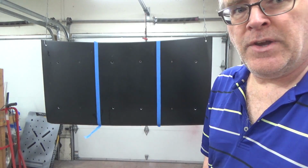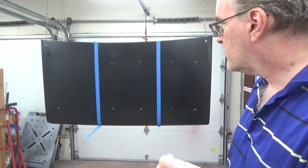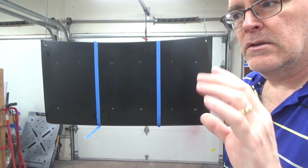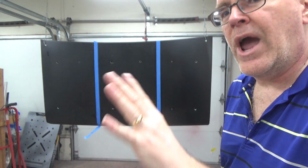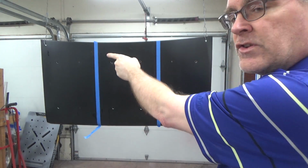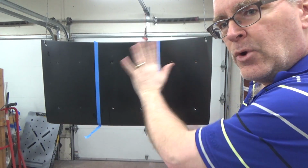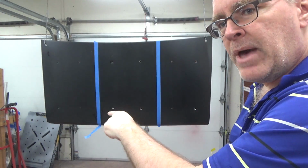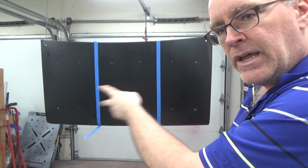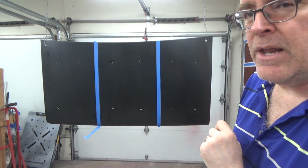I'm going to use the low temperature reducer, the ECR65 from PPG. The one thing I'm concerned about using accelerator is can you end up with dry patches, basically. So what we're going to do is put the first coat only up halfway across the panel-ish, right? And then we're going to let that sit for 5 minutes, and then come back and do the bottom half. And then we'll see in the middle there if we get any kind of dry spray line between the two. In addition, we're going to get as many experiments out of this panel as we can.